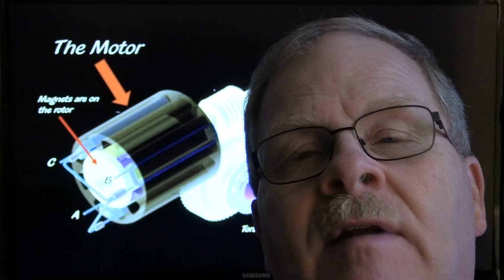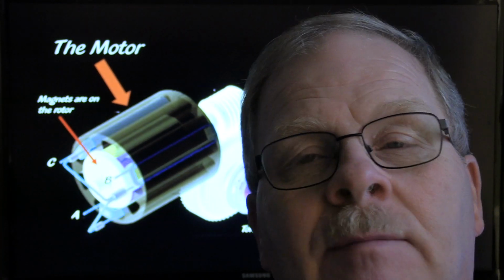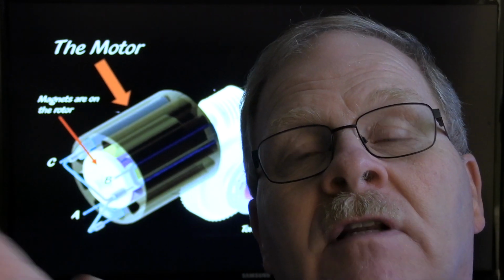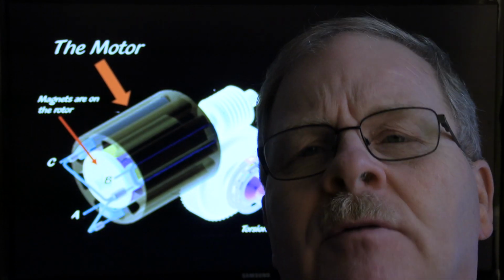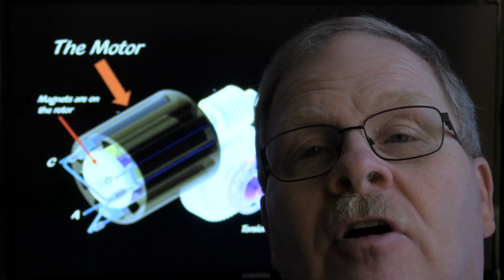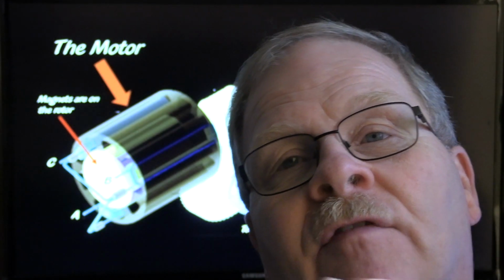And from what I've been able to tell, that's one of the reasons they use these 3-phase motors instead of brushed motors or stepper motors. They want this thing to have some torque even when it's only moving the steering just a little bit. If you look at your power window motors, they kick into high gear as soon as you turn them on. Well, with this one, you can't always have this thing jerking the steering wheel back and forth.